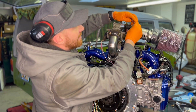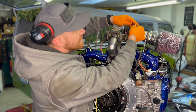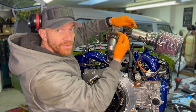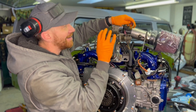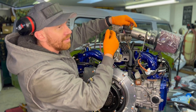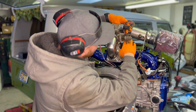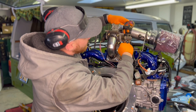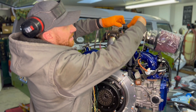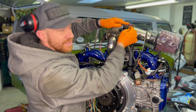You never want to just yank and have a real tight 90-degree turn to any connection. So using my heat gun, I heated this up a little bit just to bend it the correct direction that I need it to be — the opposite of what it was — and that gives it a new memory so that that connection won't break or sever. I'm going to wrap these up real nice and tidy with split loom, electrical tape, and tie them back. I'll put a zip tie there and have a nice looped connection so there's no stress on these connection points in the future.